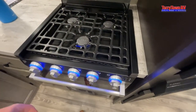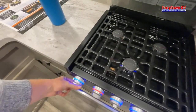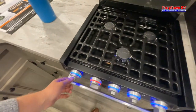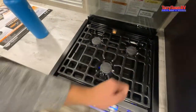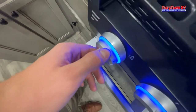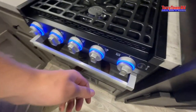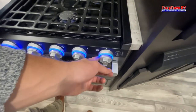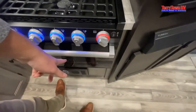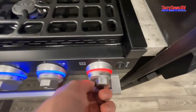For your oven and stove, go ahead and turn it on — press and turn, which releases the gas. You can see the little white igniters on all three burners. It has a little arrow — only turn to the right; if it goes to the left it'll snap off. For the oven, press and turn to the little flame symbol. Once you see a tiny little flame appear in the back of the oven, go ahead and turn to your desired temperature.